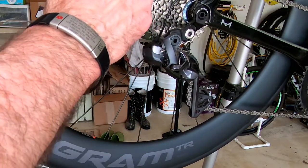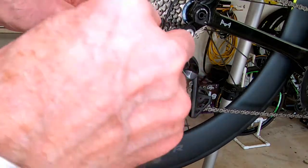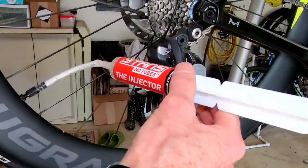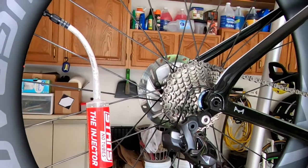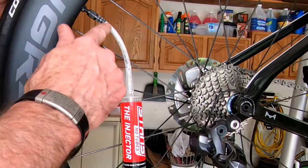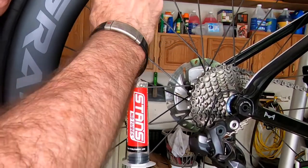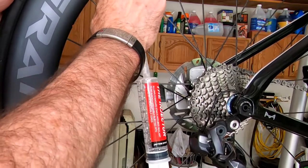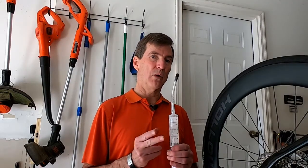So two ounces in the tire. Now I'm going to insert the plunger just to contain the mess. I'm going to rotate the tire so the valve is going to be at about 10 o'clock, which will enable any more sealant that's in here to run down rather than all over me. You can take it up to 11 or 12 o'clock if you want. Pretty clean — I've contained the mess. Now we'll wash this out with just water — I use kind of warm water — then store it until the next time I need to use it.